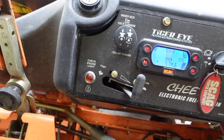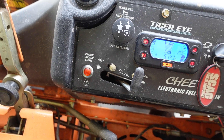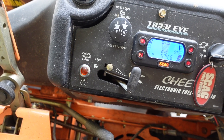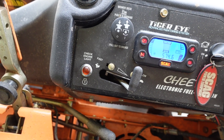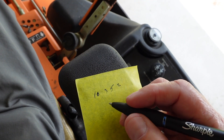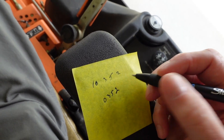Now we're looking for a 6 followed by a 1: 3, 4, 5, 6. The code will be a 6 and a 1, and that indicates the end of the code read. Now it's just going to repeat. I know from researching earlier, the 10 will be a 0, so we're looking for a 352.